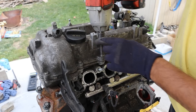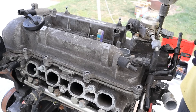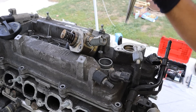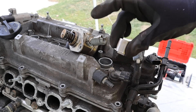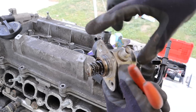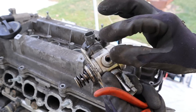I'm going to begin this teardown by removing the valve cover. First I'll remove the bolts for the gasoline direct injection pump and pop it off. Inside we have a cam bucket with a roller on it, and that's going to move up and down with a special cam profile on the exhaust camshaft, causing the GDI pump to move up and down and pressurize the fuel.